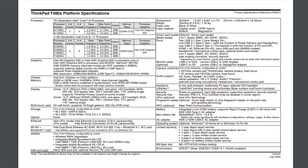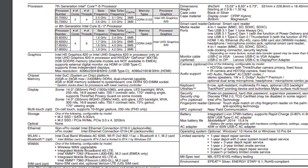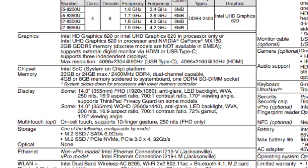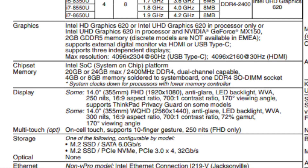Another thing I highly recommend before performing any upgrade is to visit the Lenovo website to find out the exact model of the ThinkPad you have and to check the datasheet — a PDF containing technical information. For example, from the PDF for the Lenovo ThinkPad T480S, we can see that this laptop has 8GB of soldered memory on the system board and it is possible to add additional memory to the SODIMM slot. That's what we're going to do.